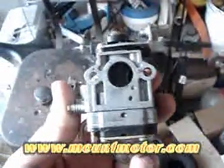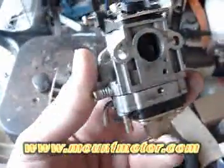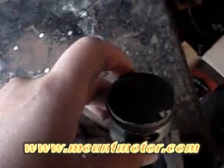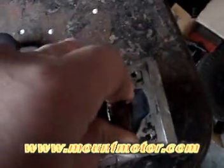So first, the process of the two-stroke cycle right here. The piston sucks in the gas from this carburetor right here, and it gets sucked in right into that crankcase. Right now the piston is at the top of its stroke. Now while it's on the top of its stroke, the gas is being combusted and exiting through the exhaust pipe. The force of the igniting gas pushes the piston down, compressing the new batch of oil and gas.